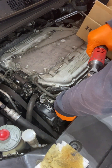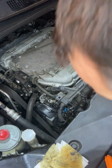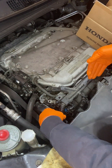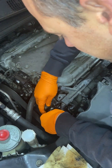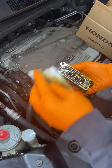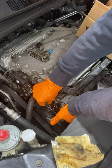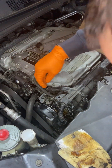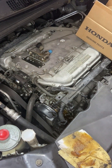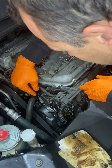I've done this three times. The moral of the story is: don't replace the gasket. Don't touch the gasket if it's not leaking thinking you're going to do preventive maintenance — that's not going to work. A lot of people loosen up this whole thing and move it off to the side. Clean this off so we can look at it. From what I've seen online, nobody ever has good results just trying to replace this gasket.